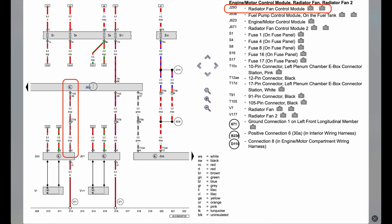J623 is the engine ECU. This is the communication wire coming from J623 to the fan control module — that's your wire in the plenum box. We're going after pin three; it is a brown and gray wire in my case, and that was the wire I teed into. I hope this video helps you guys keep your transmissions cooler while you're off-roading — get out there and have some fun.